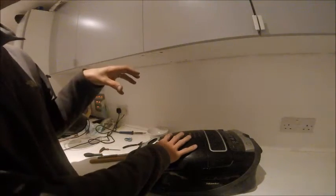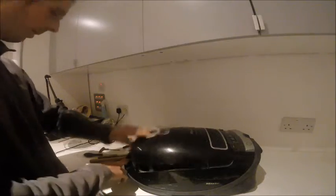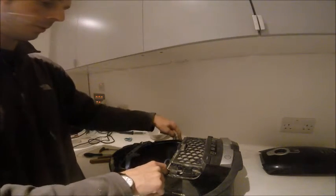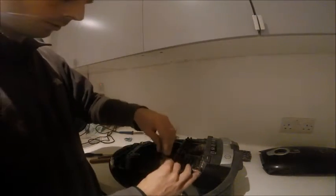I've taken the bag off and the nozzle off just for simplicity, so there's no bag in here. The best thing to do is to take the lid off — you just lift it all the way up and it pops out the top. Then there are four screws on the outside, and then there's another one under the filter, so we take the filter off and undo all these screws.